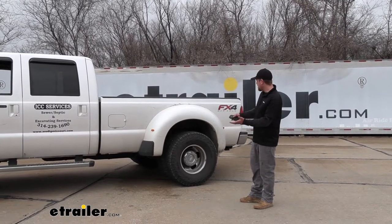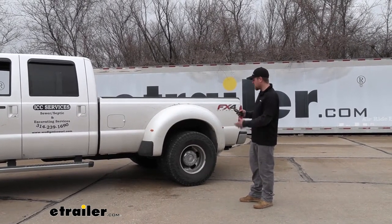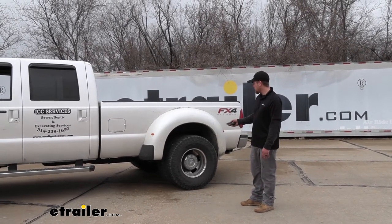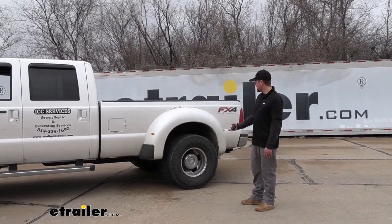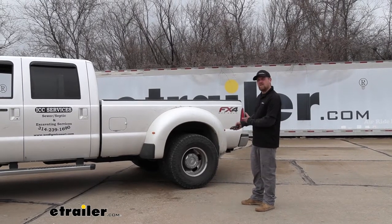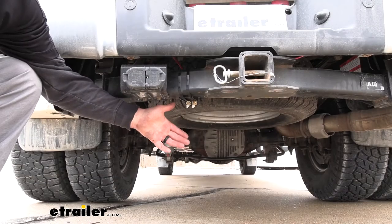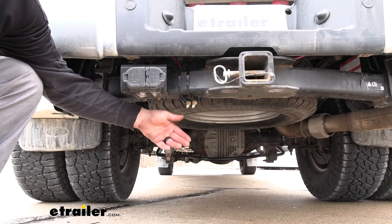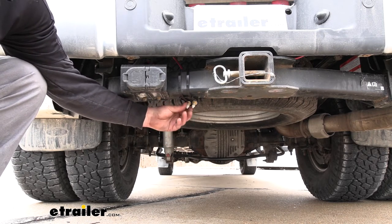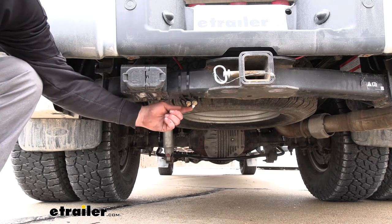You can come outside and kind of see how you're sitting, and if you need to increase the air pressure to level yourself out, you can do that right here. Say you make an adjustment — the compressor will kick on raising the back end of your truck. You might need to take a little out or add a little more, and you're able to do that very easily with a few clicks of a button. That sure does make life a lot easier being able to inflate and deflate your bags by the push of a button, as opposed to having to manually inflate your airbags with the traditional style Schrader valves every time you want to make an adjustment.